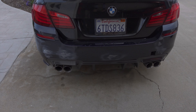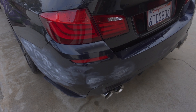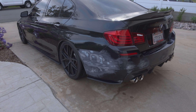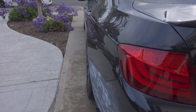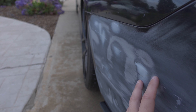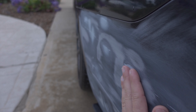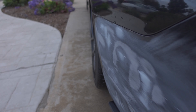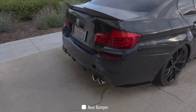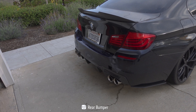It's been a couple of hours but I think we got it all wrapped up. Let me show you — the rear bumper. I rinsed everything off to get the dust off and see what we're working with. Overall the rear bumper is all good — everything is really smooth. I ended up going over everything with up to 2000 grit. I don't know if that's too much, but it feels really smooth and I think the wrap shouldn't have a hard time sticking. It looks done. We can officially cross the rear bumper off the list.